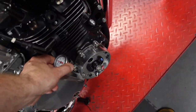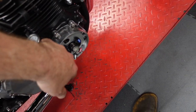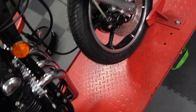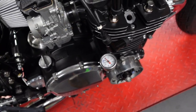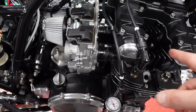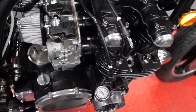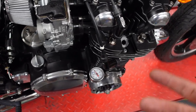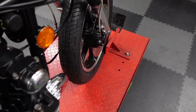And actually, this is the second gauge. It's a very cheap gauge, and they say cut this little thing, and then when you cut this little thing, it leaks oil out of that little thing. And you'll have a little puddle of oil under your bike after you go for a ride. So I took it back off, but for this one, we'll see if it can build up oil pressure. Don't really have a good way to know that it's pumped oil up into the camshaft area, other than to say, okay, if it's building pressure, then it must have gotten up there. So I took the plugs out, ignition is unplugged, and all I want to do is just spin it over.